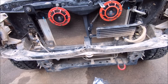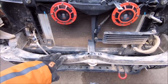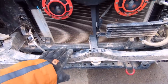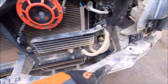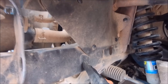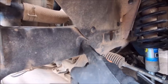Getting ready to do a dry fit for the bumper to see if the winch clears. We're going to take off this crossbar — it's just two 10-millimeter bolts, one on either side and two in the middle — and try it without this first. The grille actually mounts using this hole, which will go away, and the two side holes. For this bumper specifically, I'm going to take a little pry bar and knock off this plastic piece right here. Not sure if all bumpers need this, but we need access to this hole to mount the mounting plates.